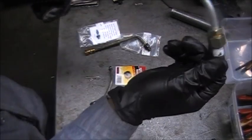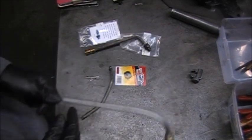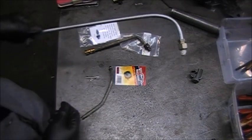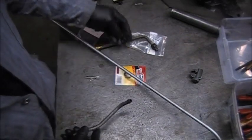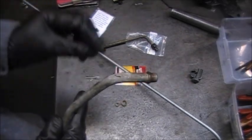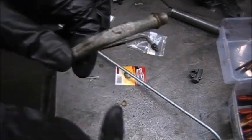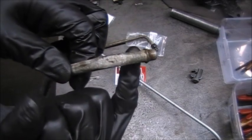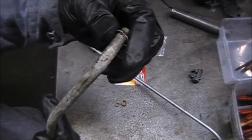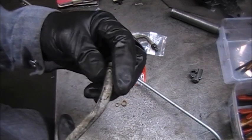What you would end up having is this line right here, and you never have to worry about this actually breaking out or blowing out and causing the problem again. This is what I use now because I've had that problem. The only other way to fix that situation is to buy a new line. Why? Because this ridge around here wears out. And I don't care if you put a new clip in there, it will not hold it. When that pressure gets to pushing that line back, it's gonna slip out.